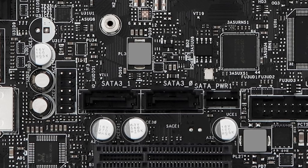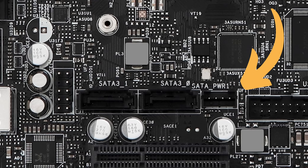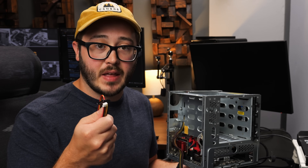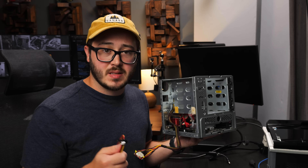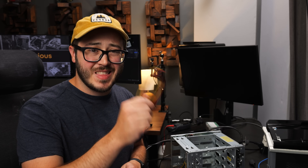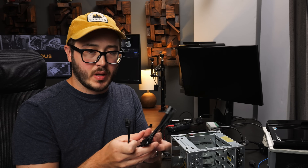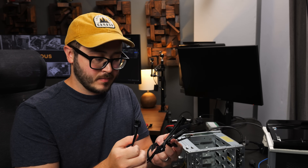Let's move on to figuring out how we're going to get power to this SATA backplane. This motherboard has those two SATA ports and because it's powered from a barrel jack, it has a little adapter for two SATA power connections. I could go the easier route and find some SATA to Molex adapters, but I forgot to order them in time. So I'm going to do the next best thing and make a custom cable. I happen to have a bunch of these Zima board adapters, and I found that this cable matches up with this motherboard and has the four cables I need. I should be able to snip this off and wire it up to a Molex cable for my Corsair power supply — a probably not-so-safe adapter. I'm going to figure out the pinouts, get to snipping and soldering.